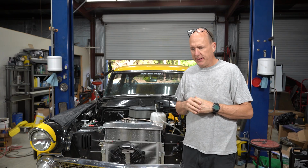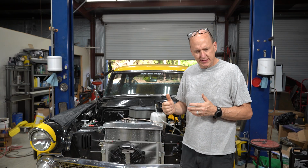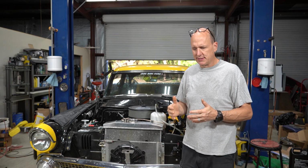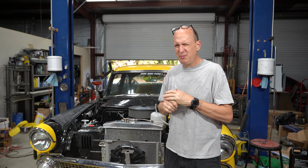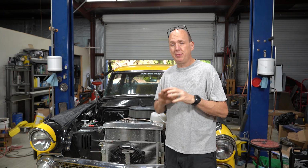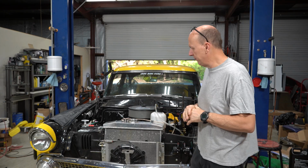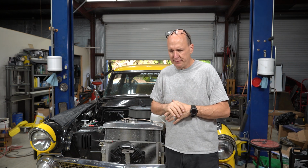I actually found a bad leak in the rear brake line, which is weird because I didn't touch those, but I had done the flares originally with a cheapy flare tool, and I think I just had a bad flare, so I rebuilt that brake line last night. Seems to have remedied that situation. It was under pressure overnight, so the brakes seem to be fine.